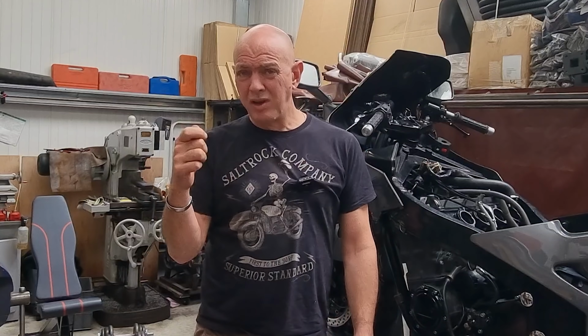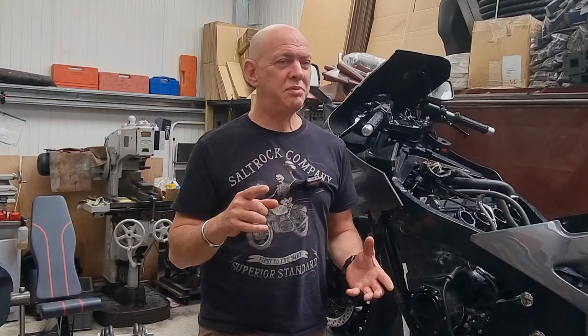Both the coils are actually getting replaced anyway, just because they didn't meter correctly. I think it's supposed to be between 2.3 and 3.5 on the primaries, and it's just reading high. They're not reading as the manual says they should, so they're both getting replaced. Now, there was a fella who chipped in saying you can do a stick coil conversion. I quite like the idea of that because it's a bit later technology, and it could be good, but I might do it, I might not. People say you don't see any marked improvement with it. I don't know. But I've got the regular coils coming. They're not OEM ones because they don't make them anymore, so these are ones off eBay, which means they'll probably last 5 minutes. But that's what's going on, essentially replacing it.